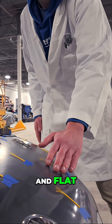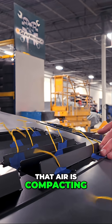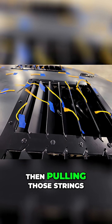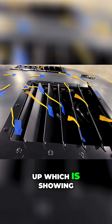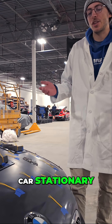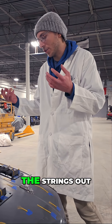These are staying nice and flat. And then, as you make it to the leading edge, all of a sudden the air is compacting, coming up and over and creating that low pressure zone that is then pulling those strings up. That's showing that the air is actually coming out of the louvers — and that's with the car stationary, no air flowing in it. It's just that low pressure acting as a vacuum to pull all the strings out.